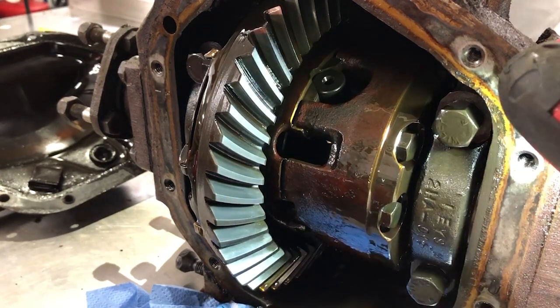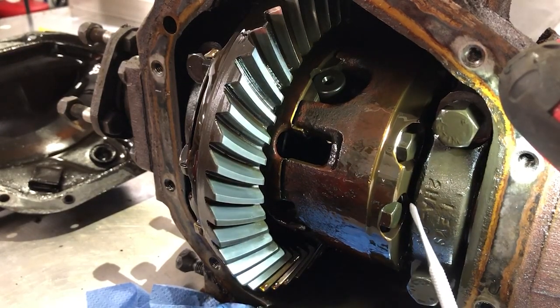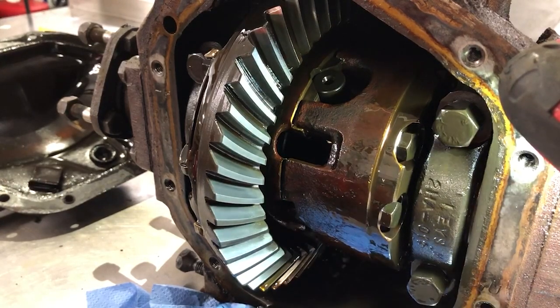The question is, is it really worth doing a full rebuild on what is probably a healthy differential? The fact is, it will not only ensure that this differential works properly — the backlash will be correct, the bearings will be new, the seals will be new — and it will be given a cosmetic refresh on the outside as well. So I think it's probably worth sending this to a specialist. I could do it myself, but I'd like it to be absolutely right.